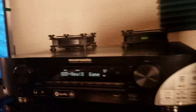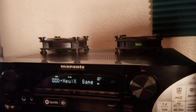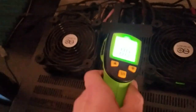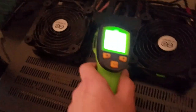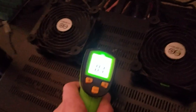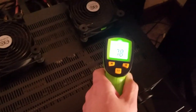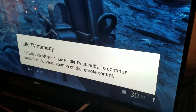Now let me turn the fans on medium. I've obviously got a ton of audio coming out of the receiver. The unit's been on for four hours without any cooling, and I've just turned the fans on to medium speed. Let's check the temperature one more time. A little quicker now, and we seem to have a dramatic decrease in the temperature — I'm not even reaching 90 degrees anymore. Getting as far back as the warmest point, we're measuring 86 degrees so far. That's looking pretty substantial.